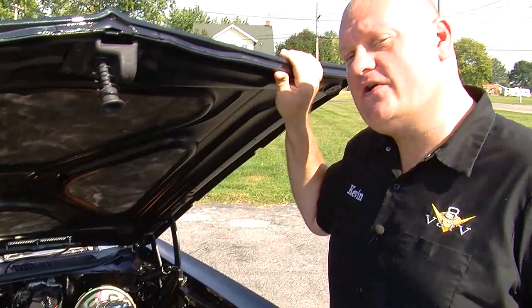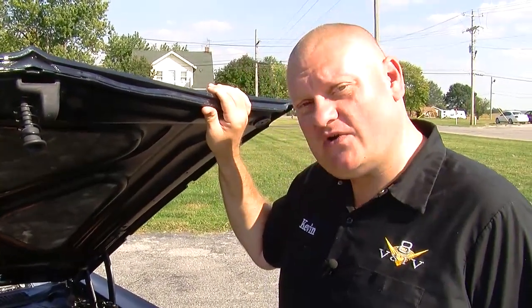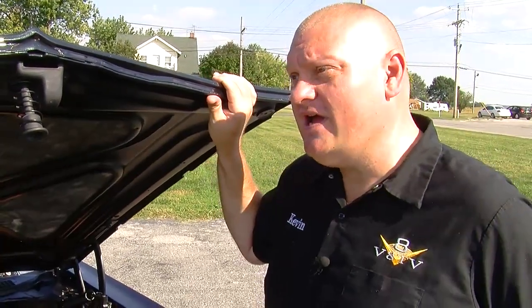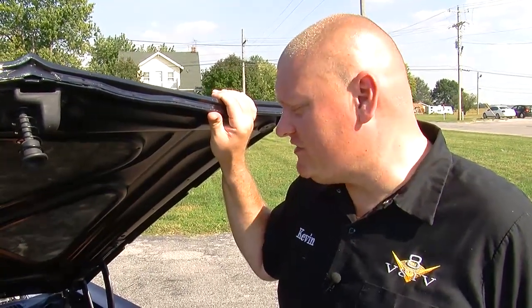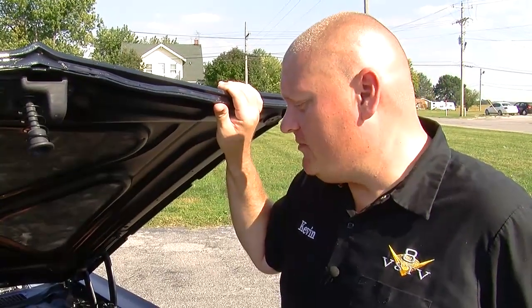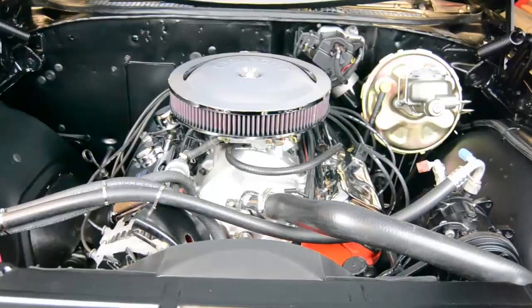It's got all new internals, a good crankshaft, a performance camshaft, higher compression, electronic ignition, and a Holley 870 carburetor. So this was built primarily to around 1970 LS6 454 specifications, which would put it right around 450 horsepower. But it still looks kinda like a stock 396.